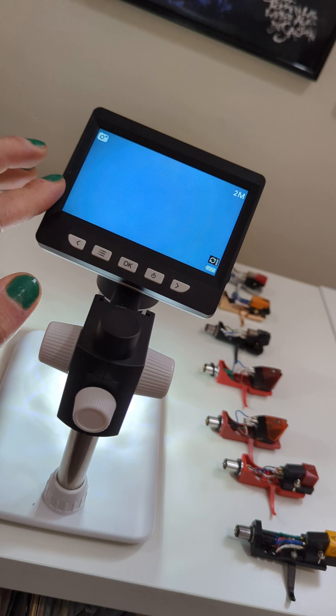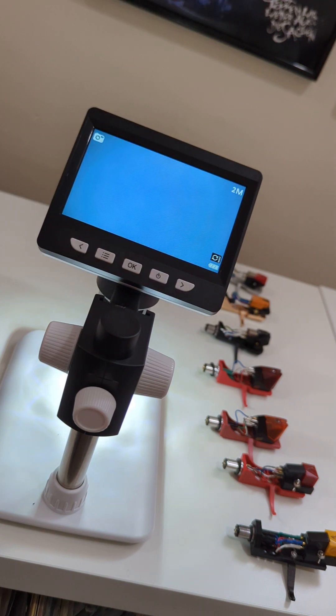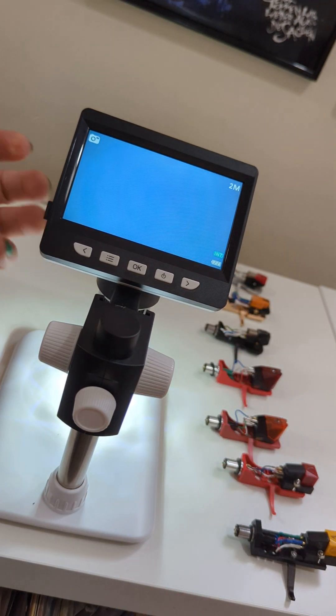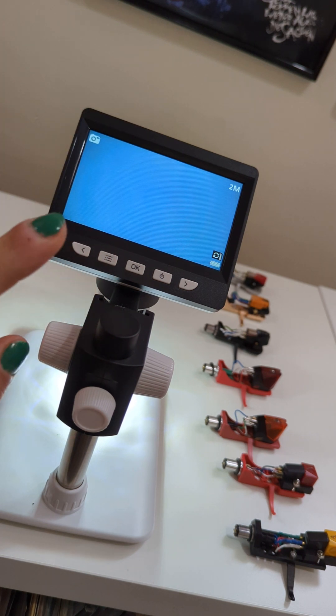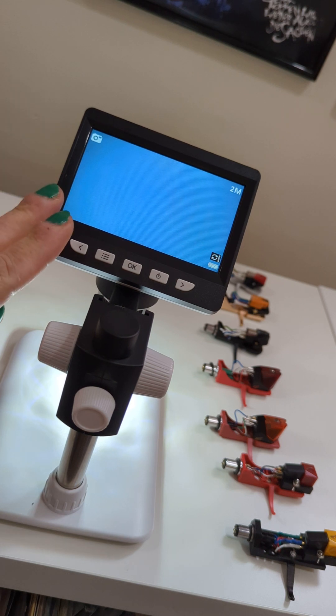Mine took a bit longer, so there might be an issue with this unit. But as you can see it's running well and I've been using it ever since. It keeps saying 'SD removed' regardless — like I said it just does not want to cooperate with the SD card. But you can plug it into your PC. I've been testing it on Windows, Linux, and Mac. Works fine on Linux and Mac. On Windows 11, after connecting it does see the external camera and I can see the pictures, but saving comes out with an error.